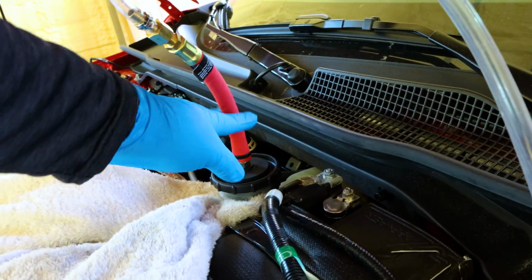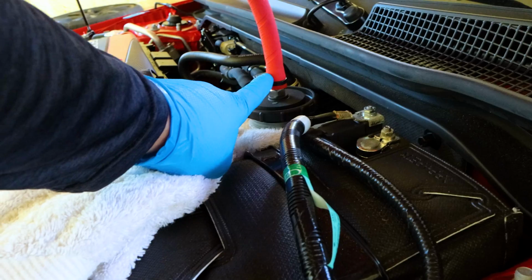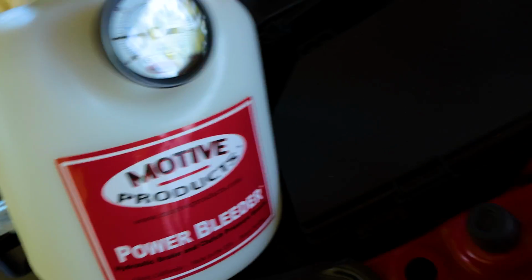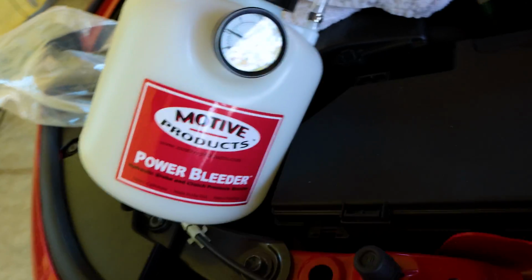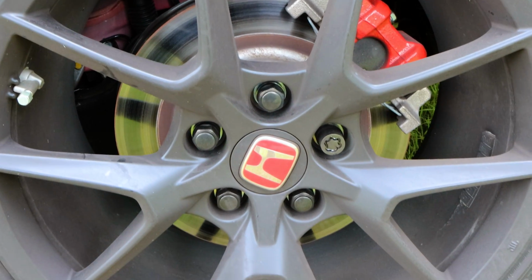So I went to Harbor Freight. I bought this airline here for $4. I cut it off, and I'll show you guys what I did over there, but I cut it off, and I put the cap that's in the link below into that air hose, and this screws right into this air hose. And I just pumped it up a little bit. It's only a 5 psi, but I can pump it up some more. You know, it'll give you some psi there, and this is what's left over. That's all I did. So those are the things you'll need to change the brake pads on the Civic Type R.